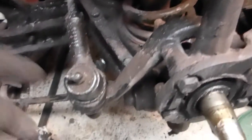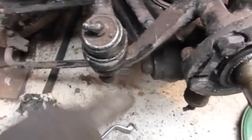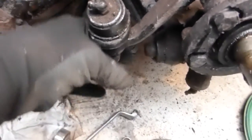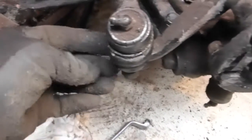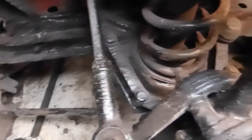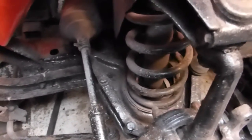That gives me access to break this joint. The big bolt on the bottom has to come off along with all the seals so that the trunnion bushes can be changed as well. Now I've got good access to the whole wishbone assembly, and I'll now take out the shock absorber.